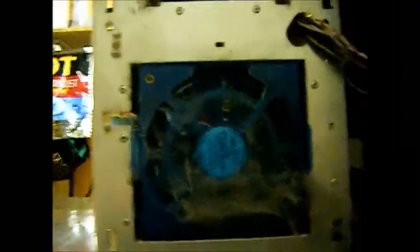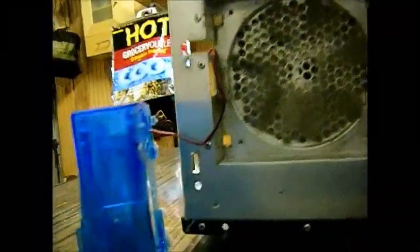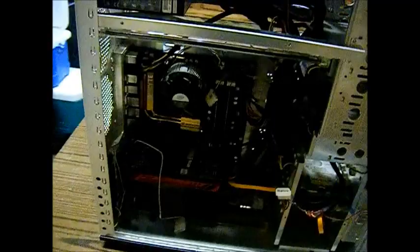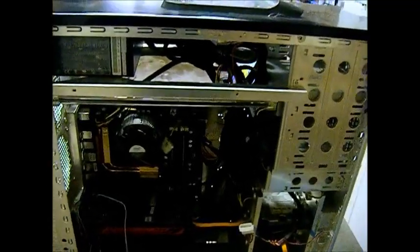To get this front fan off — same concept. It has about two clips, one on each side, and you just pop it out like so. Once again, the wires go inside the case, just follow it and unplug it. I'm also probably going to do some wire organization while I'm doing this, which is always a good idea because better wire organization means better airflow, better airflow means a cooler computer, and a cooler computer means better performance and longer longevity.